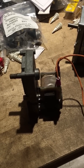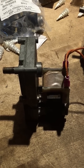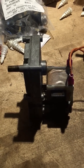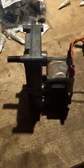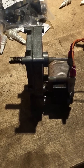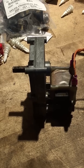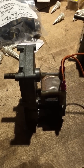Here's the first motor. As you can hear it doesn't sound too bad, but it is kind of rattly, kind of worn, dirty, dusty. If it is jamming and not working correctly or not feeding the pellets correctly, I would recommend replacing it — and that's exactly what we did. When you replace it, of course always check the auger bushing or bearing to make sure it's clean and not gummy or sticky, to avoid prematurely wearing out a brand new auger motor.